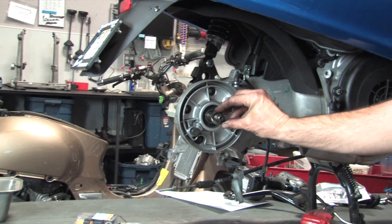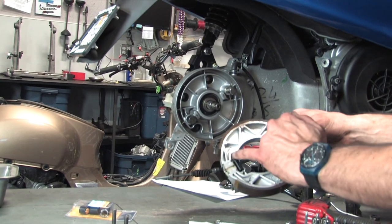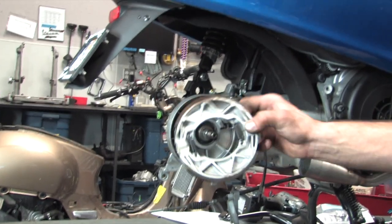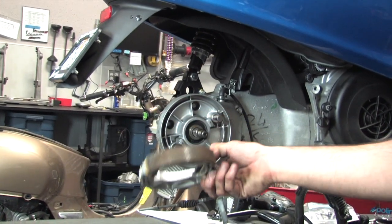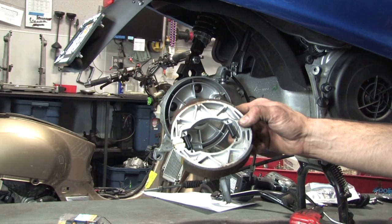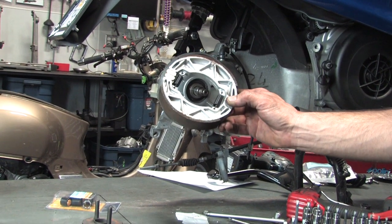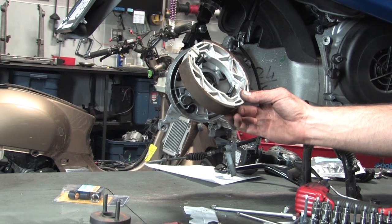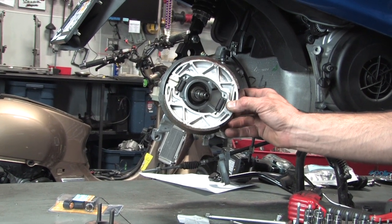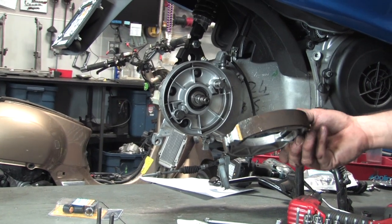Go ahead and put the thick washer back in, then reinstall the brake shoes — I have my markings of what side faces out. You can clean them up with 80 grit sandpaper and spray them off with brake cleaner if you wish. If they're worn out, replace them. These look brand new — about five millimeters of brake shoe on there. When they're down to about three millimeters, they're pretty much worn out.